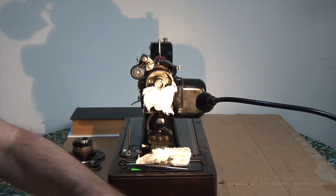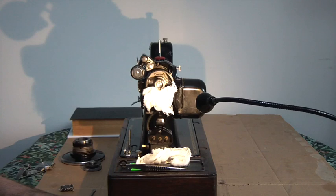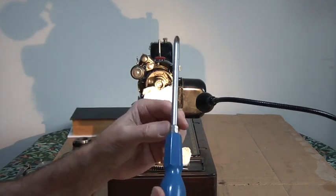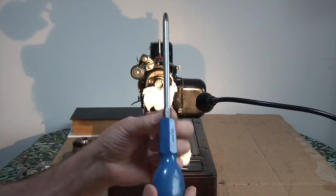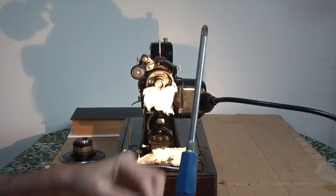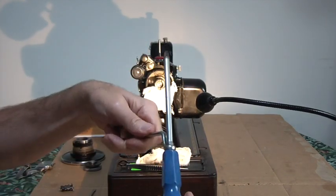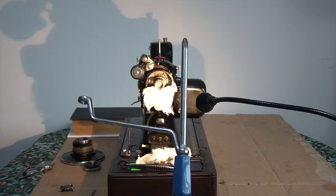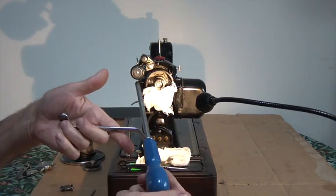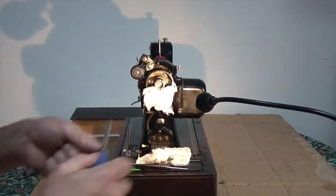Third way, and I'll just drop these out, is that on this particular type of screwdriver, it's got a hexagonal shaft right at the end, round shaft for the main part, hexagonal at the end, and this will allow you to put on some form of spanner, which then gives you the ability to then twist that one off as well. So you're getting more leverage out of your screwdriver.